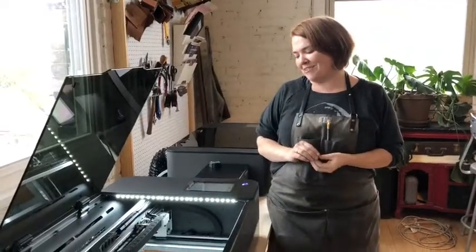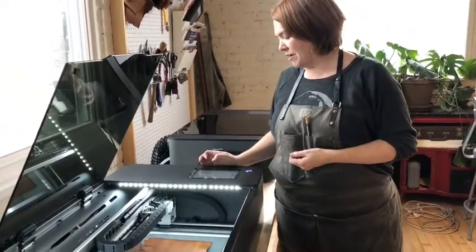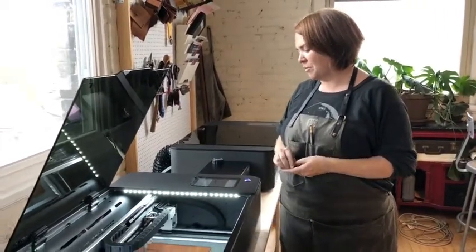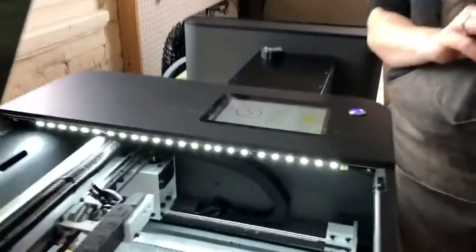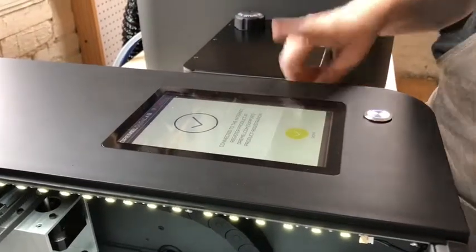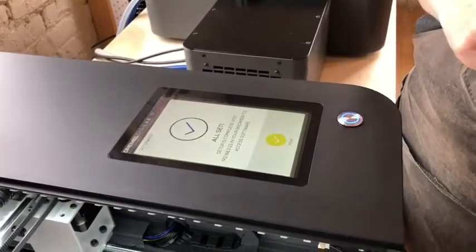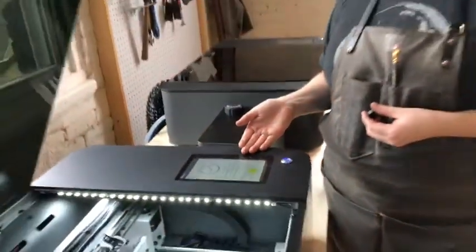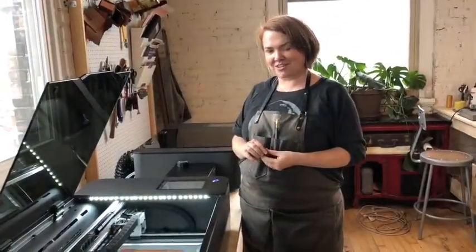Now it is looking for Wi-Fi, so we choose our Wi-Fi network, hit next, and put in our password. Now the laser is connecting to the internet. There is a registration address here — be sure to go online afterwards and register your product. We're going to hit done. One more thing about setting up your laser cutter: if you notice that when closing your lid a sensor isn't triggering, it can be because the laser or the table isn't level. There are adjustable feet on the bottom of the laser — screw and unscrew them to adjust the height until the laser is level, and then the door sensor should work just fine.